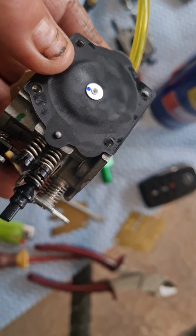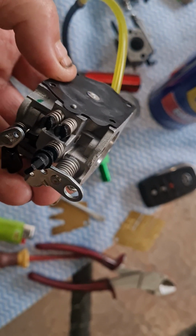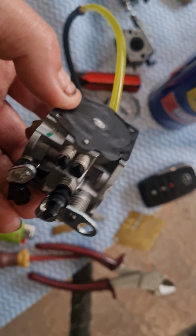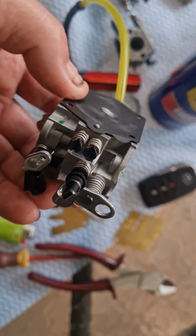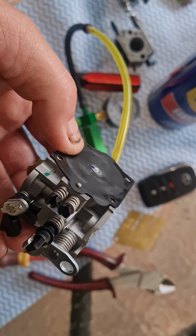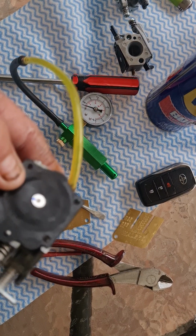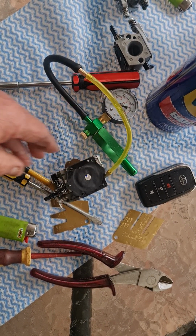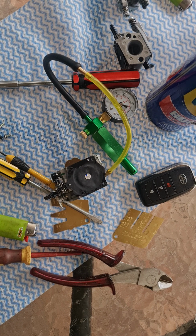Last video I talked about the Taylor 35 cc. It's got a WJ71 carburetor, but that metering has been adjusted. That wasn't by me, it was from Taylor, because that originally was on my Supreme 71 engine. I'm not going to pull that apart and adjust it, but I'm interested to see what the pop-off is on that. Anyway, I did run it, I shed 1.5 kilos off. It absolutely goes now. If I had plenty of grip and all that, I figure a 9,500 spring would solve the problem. When it hits the loose stuff, it gets on pipe real easy. Yes, it's going good.